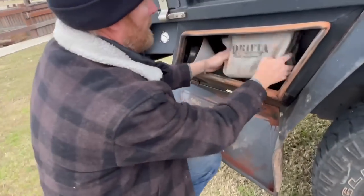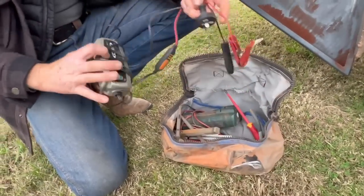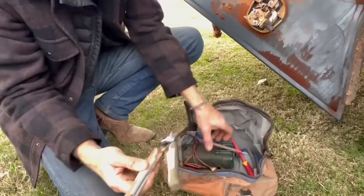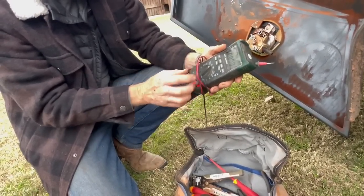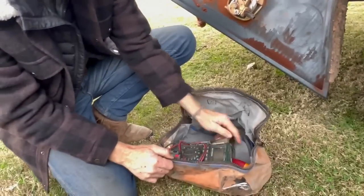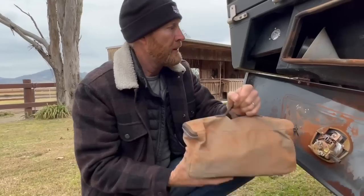These little Alia box bags — clear top — are ideal for the electrical gear. I've got a small charger that if my battery went flat I could run from my lithium to charge the battery in the front. Wire strippers. Probably the handiest thing you can have is a multimeter — get it on volts and you can do a lot. You've also got to know how to use it. A volt meter tells you a lot more than a test lamp, which only gives power or no power. If you can learn the basics of a volt meter they're invaluable for electrical problems.